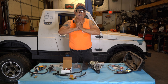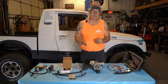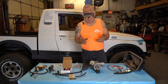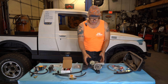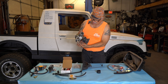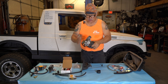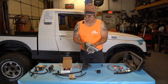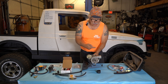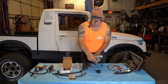We're going to use a K03 turbo. Because I don't sell the turbos, when you get your turbo you're going to have to clock it. A lot of people call me and say it's upside down. The way you clock it is you've got these wings with the 10mm bolts — you loosen those bolts and spin the wings out of the way. That center chamber pivots so you can get it in the correct position. Your charge tube goes that way and your air inlet is pointing forward.